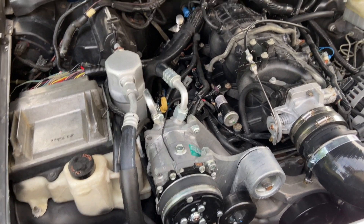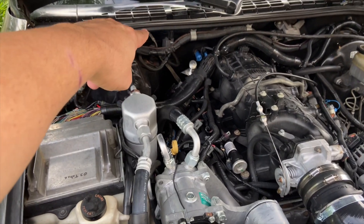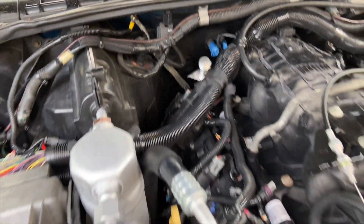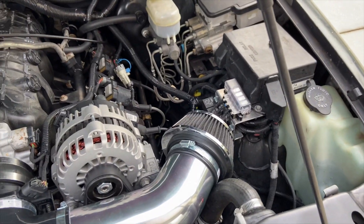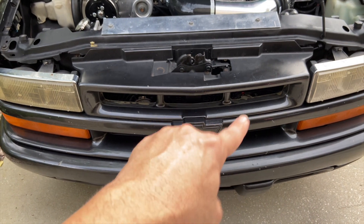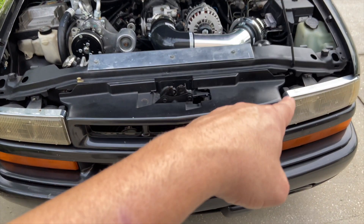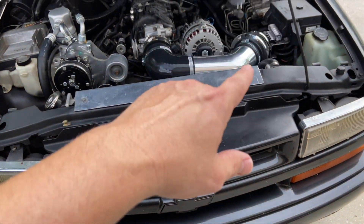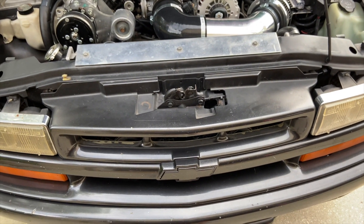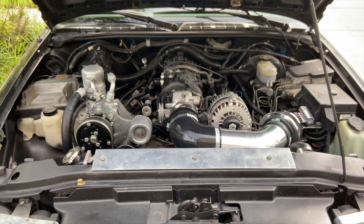For the fans — you can see the wiring diagram — I ran a ground wire back through here on the trinary switch circuit, grounded one side out on this ground here, then ran a wire up with two diodes in it to my fan relays. I had dual fan controls from the computer: one fan comes on first, then another depending on temperature. I didn't want both fans to back-feed into the trinary switch, and I didn't want the signal to back-feed into the computer either. Even though it's just the ground, I felt diodes were the way to go.